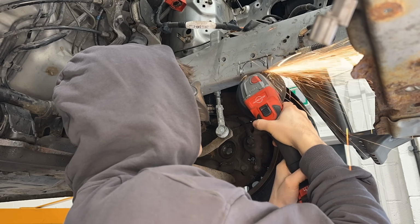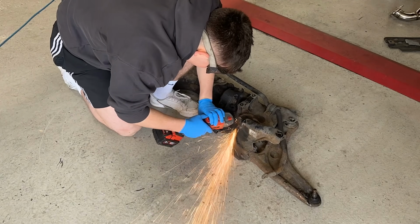As for the water pump pulley, all we have to do is make a little hole in the chassis leg and weld it up, something called a chassis notch, which if you guys have been watching the whole series, we've already done on the passenger side chassis leg and the subframe. So they're not too difficult to do, but the big bump in the road is that both of those problems require the engine to be back out in order to fix.